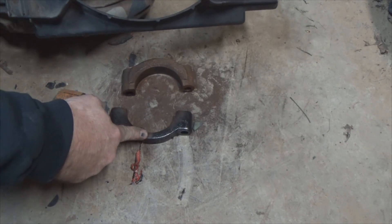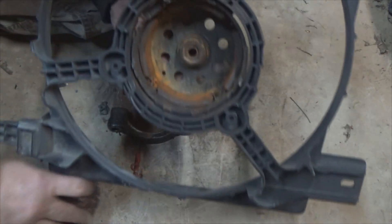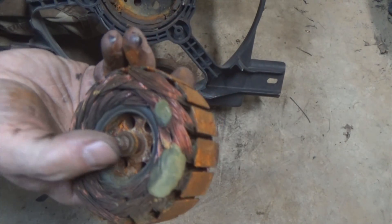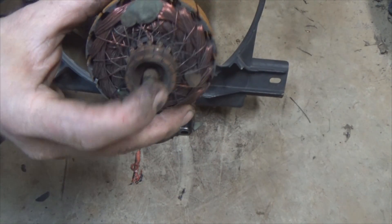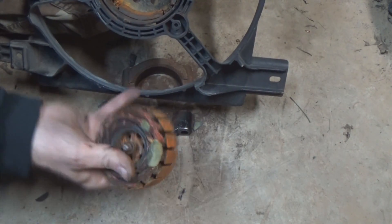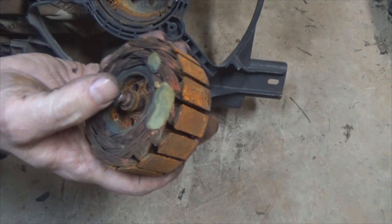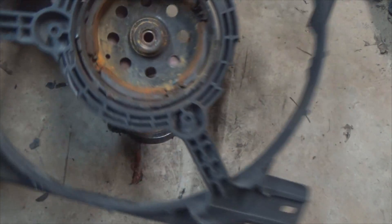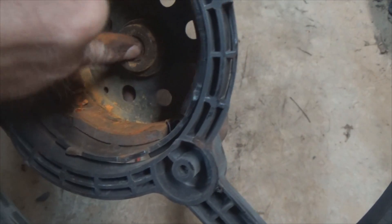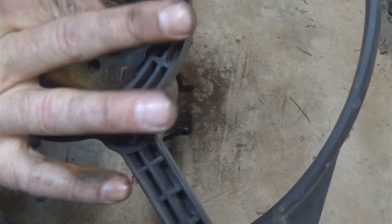What I had to do: I put engine main bearing caps around this right here to keep it off the ground so as I hit it with a hammer, this end wasn't touching the ground — it allowed the armature to slide out of there. If it was hitting the ground I'd just be driving shaft end to end, which would do no good. By supporting it, it allowed it to slide out of that bearing. And looking at it now — that's actually a roller bearing right there.